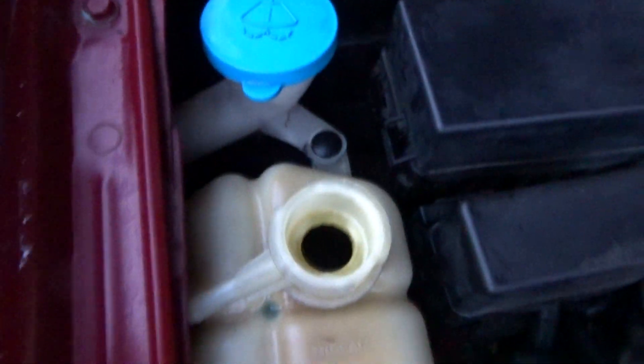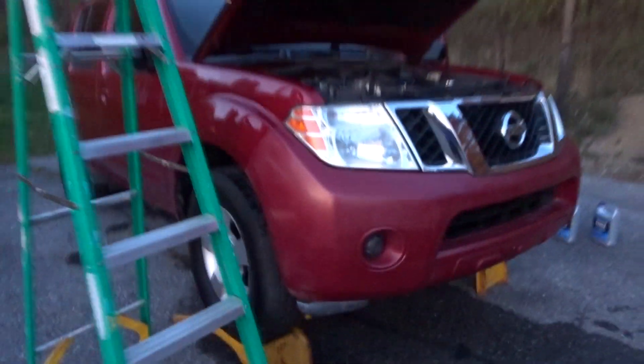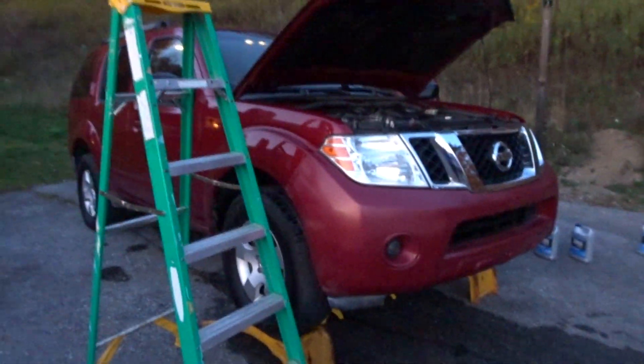There's a little bit too much in there still, but it's not bad. Now that we got our antifreeze leveled, we took enough out to where it's at the right level. We put the cap back on. Now we are going to take it off of the ramp, and then we're going to take it for a 20-minute drive, keeping it between 2,500 and 3,000 RPM.